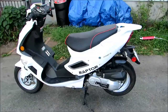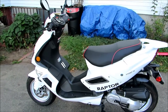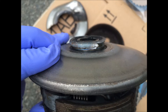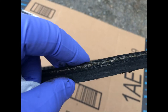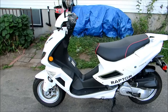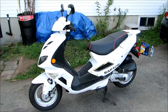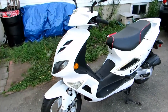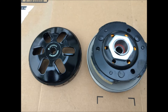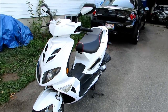The second time I got stranded was when the rear clutch pulley — inside that back box — broke, making strange sounds and shredding the belt. That's my fault, not the scooter's, because the big bore kit meant the pulley and belt were overworking with more torque and higher speed. I installed a new racing clutch and a Gates Power Link CVT belt, and I haven't had any issues since — about 700 miles on those now.